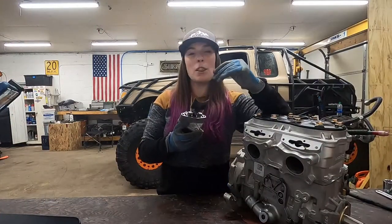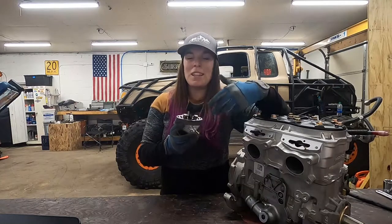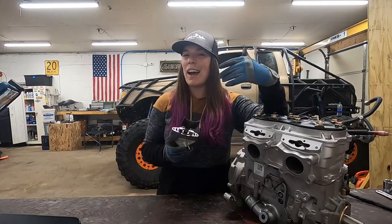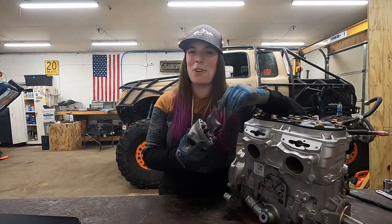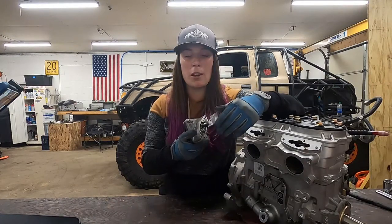Typically machines that are run at lower speeds and steady RPM tend to have a faster build up than machines that are run at higher speeds and varying RPM. This does not mean you have to go full throttle everywhere — what this means is that varying your RPM actually actuates the valve, disturbing that soot and carbon build up.